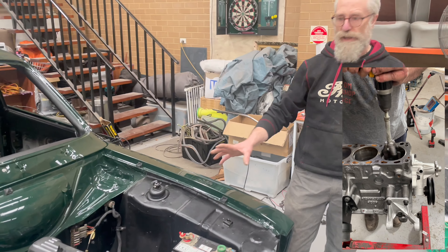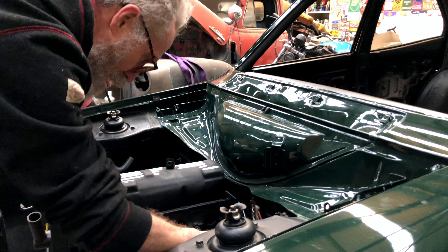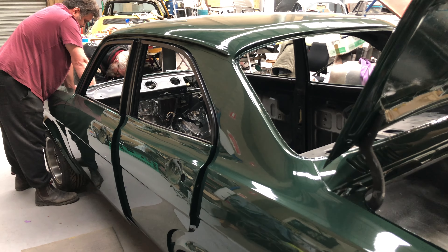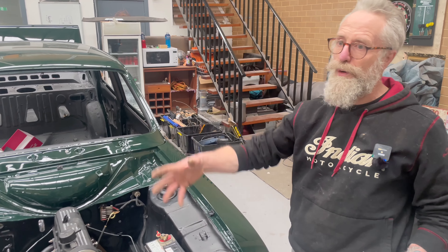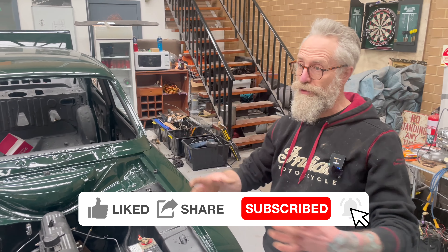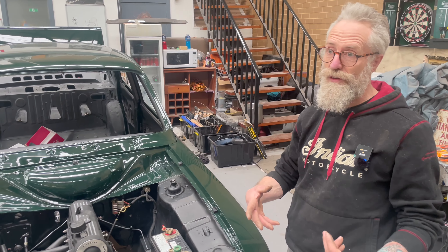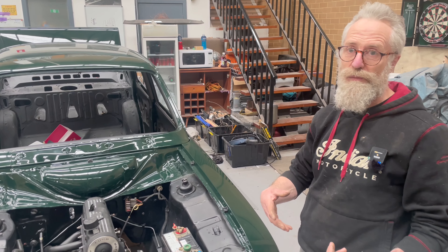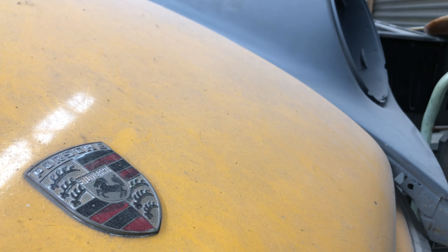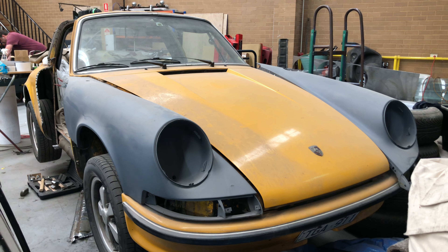Is the client guided by you in the styling? I will steer, I'll give him options. So he went with that and we've gone a Lotus colour scheme — blacking out through the windows, blacking out the rear, and it's still going to have the chrome and bumpers that will give it that Lotus kind of a look. Finding all the parts and going through them. The motor — we had two motors to choose from. This motor has been worked. We pulled it apart and found it was all rusty inside. It had been reconditioned but had a little bit of water inside. So we had to hone the bores, check the head, put on new components like valve seals, lap the valves. So here we do a little bit of mechanical as well as body work.